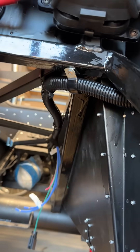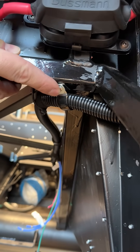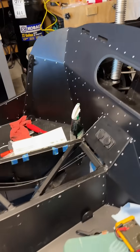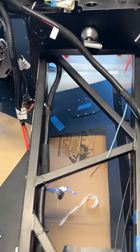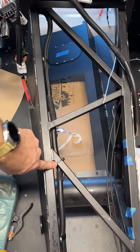I'm using a couple of locations. I'm using cable clips with rivets to hold them in, and then there's a few other places I'm using zip ties, due to access with a drill and things like that. Coming along the driver's side of the trans tunnel: cable clip, zip tie, zip tie, another cable clip, and then another zip tie here.